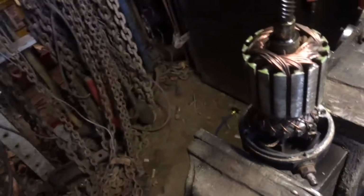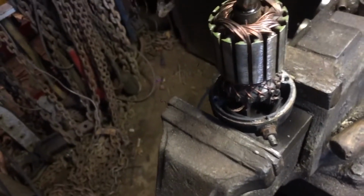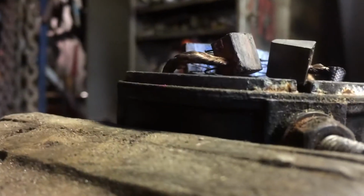Now I'm going to try putting the cap in the vise and putting the coil in after that. I don't know what it's called, but I'm calling it a coil. It's coil of copper wire. There you go. Let's see if I can push these down, or well, maybe I can just set them up on top of the springs where they belong. Sorry about the interruption. I don't have enough space on my phone to take these videos. Let's see if we can fit that on there like that, and then weasel those brushes into place with the screwdriver and my fingers. So they're not too far off from where they belong. I'll take that off.